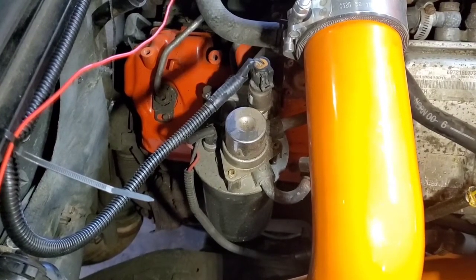It's kind of a double-edged sword. I say that because fuel filtration is key. Now, yes, this truck does have an Air Dog on it, but I don't like deleting that factory fuel filter. It has the fuel heater in it, it has a water-in-fuel sensor, which I know they're problematic.